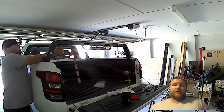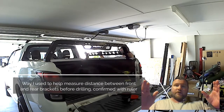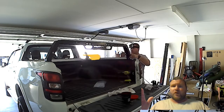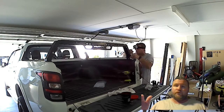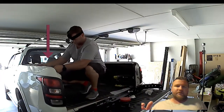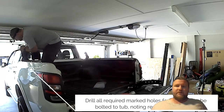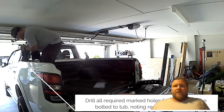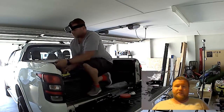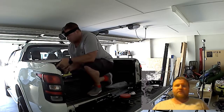Here I'm using the side railing and the front bracket — on my one I was able to use a pre-established drill hole to measure out the distance, and I'm marking the holes for the brackets as it's sitting. I also double-check with the ruler before I go ahead and drill the holes to make sure I'm getting it correct. Regardless of how you go about establishing where to drill, double-check with the ruler — I don't want to drill an excessive amount of holes if you don't have to.